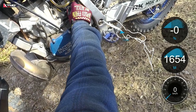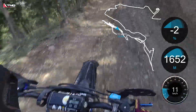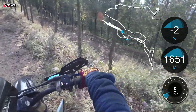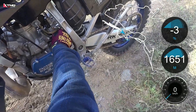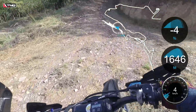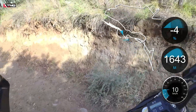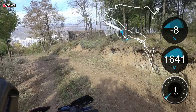Let's adjust the torque gain screw clockwise by half a turn. The top end performance has noticeably improved this time, but we believe it can still be better. Let's completely disable the torque gain circuit to see what changes. Once again, the top end improved. This time, we've reached what seems to be the best possible top end performance. Although the test distance wasn't long enough, I could clearly feel improvements with each adjustment. Based on the current results, the Gene III Plus 36 and SC236 perform better at the top end.